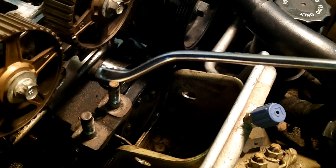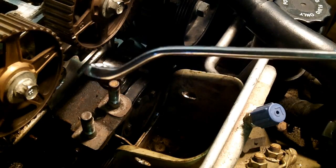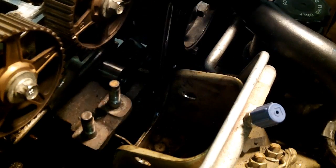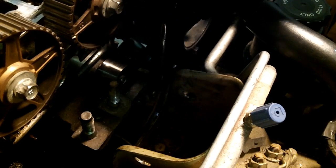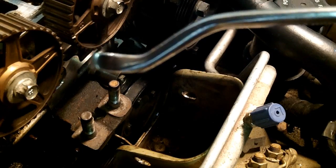You know what kind of wrench I need to get at that, and it's not a straight wrench. I had to go up to the store and get an offset wrench. This is a 10mm offset wrench that I got from Advanced Auto Parts. It's a fairly nice looking wrench, and that will easily allow me to get this on that pulley bolt because it's recessed behind the pulley. Even with that tension, I still have to actually hold the belt in order to have enough resistance so that I can work with these bolts. But there's absolutely no way you're going to be able to get this job done without a 10mm offset wrench. This is a requirement for this job.